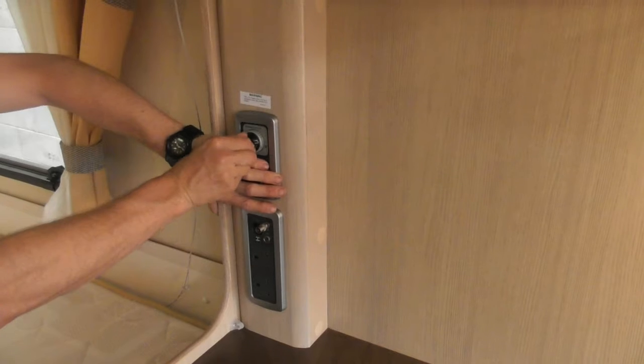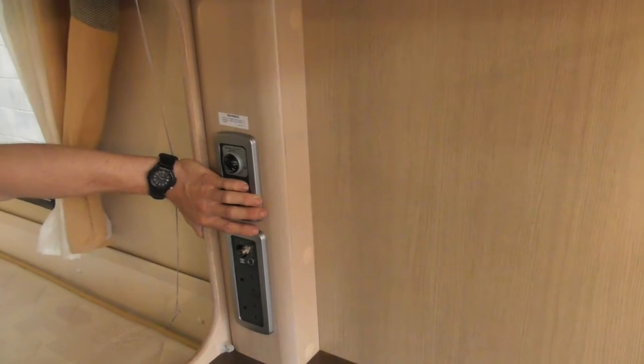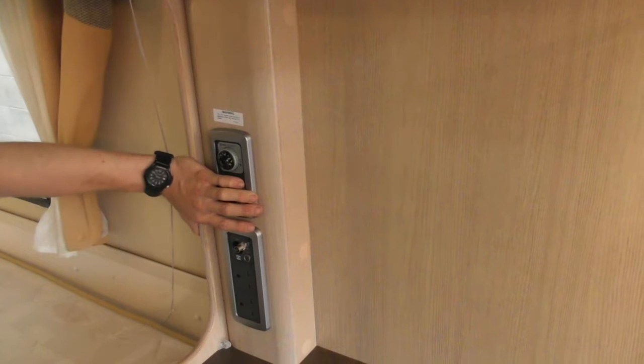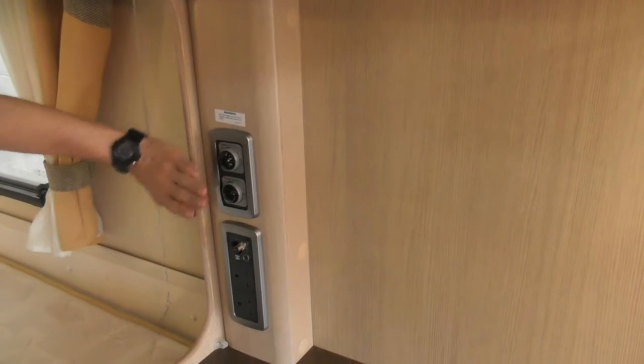Thermostat in the centre, so you've got the same temperature, maximum 70 degrees. The electric, it's just that. You haven't got any alteration of that thermostat. Well, if you're just running on gas alone, you can thermostatically control down to, say, 30 degrees if you wanted to. Okay. The one below, so that's your water heating.